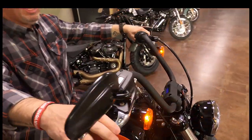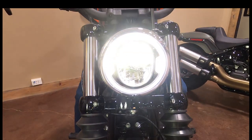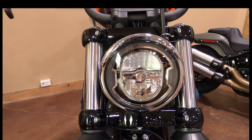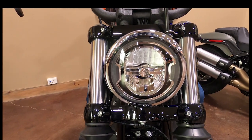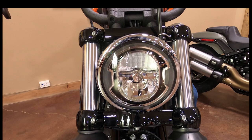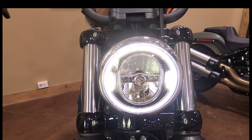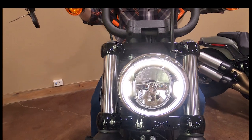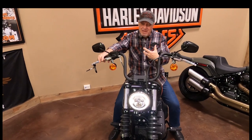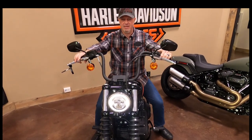There's an LED headlight, and a fun feature: this bike has a kind of parking light. If you grab lunch or have a couple of beers with friends and your bike's parked on the street, you can hold the trip button for two seconds and it illuminates just the halo portion of the LED. That uses virtually no electricity — the battery barely knows it's on — so it can sit for hours without draining your battery. It's a funny little feature but kind of cool.